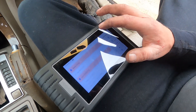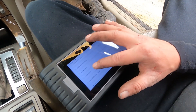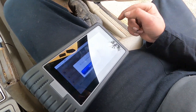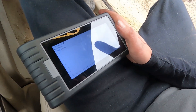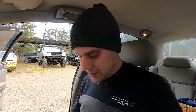You can even bring up knock present and knock retard for this car. Obviously each car you scan will have different values and different things available in live data. For this car there's quite a lot we can see: IATs, knock retard — so if you've got a dodgy batch of fuel and you're worried about knock retard, this is going to tell you. A lot of cool things you can do with this tool, and it's wireless Bluetooth which is also very handy.